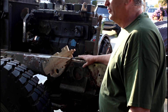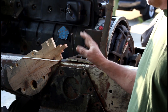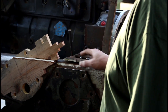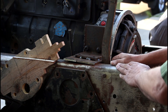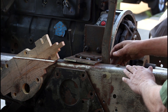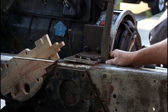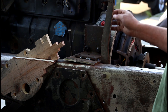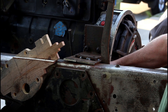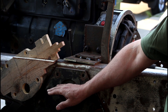In my previous video I showed you where the guys doing the sewer repairs at my house helped me drop this in. I just fabbed these up — yes the welds are ugly, I know, and it's only temporary anyway — but this is to show you that I've got a little bit of a problem. I told you in the last video I wanted to run the floor pedals and I'm still fighting that. As you can tell, that's a little bit up and down and I have no travel whatsoever for the brake pedal. So that means I'm going to have to drop this mount lower so that I have the travel I need, and it'll probably end up being around here for the lower part of the flywheel housing rear mount.